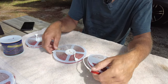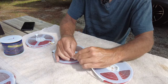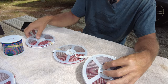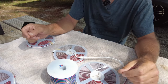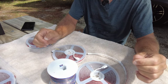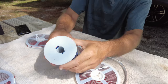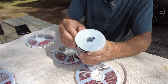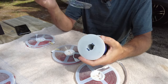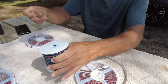The strips have ends on them so you can chain them together, but what I'm going to do is cut those ends off and solder the wire in, then heat shrink it. That way I can plug and unplug the lights when I need to take down the coroplast. So let's get going on the wire — we need to cut up a few strips and get to soldering, then climb underneath and start sticking up some strips.